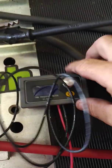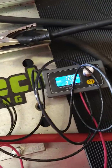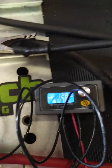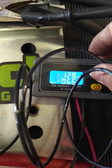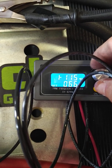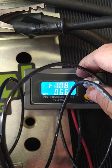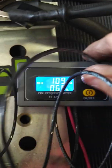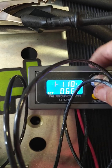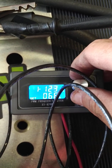Right now when the vehicle is off, the box is off. When you go ahead and turn on the power, you will get to the frequency setting. Typically when you get it, it will probably be at 100 hertz. You'll press the button until the icon flashes to where you're going to be changing the frequency. You're going to set it to 128.